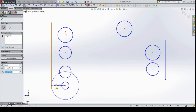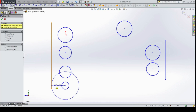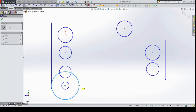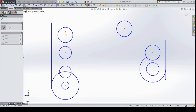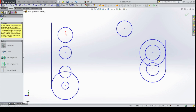Basically, what this bracket is going to do is allow me to mount the control arm in different positions so that I can try to get that lower control arm more parallel, hopefully reduce some binding. And then when I have different shock mounting locations, that's going to allow me to reduce the amount of down travel and in turn reduce the amount of roll that's possible with the suspension. This is purely an experiment — with the shock mounting, a lot of people haven't done a whole lot of reducing the droop, and I want to see what that gets us.